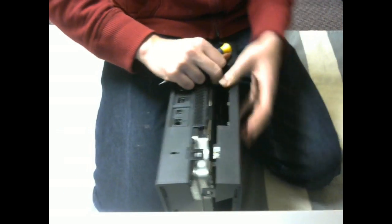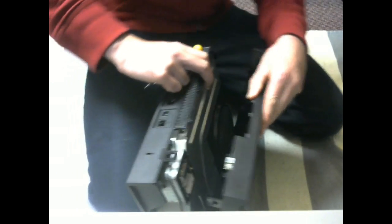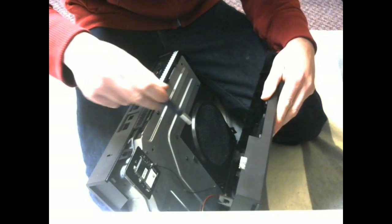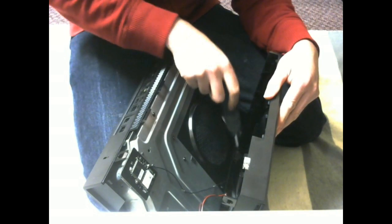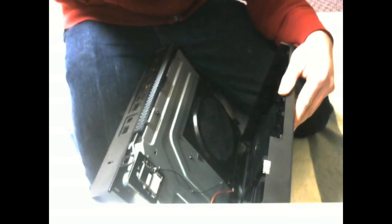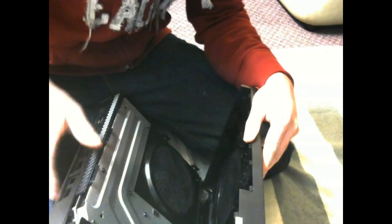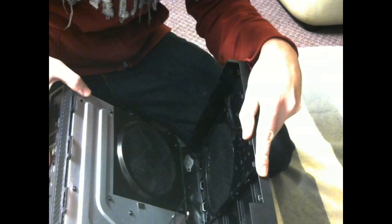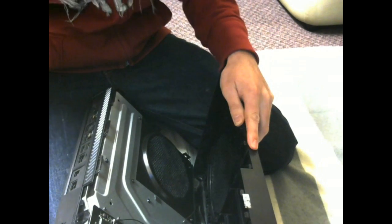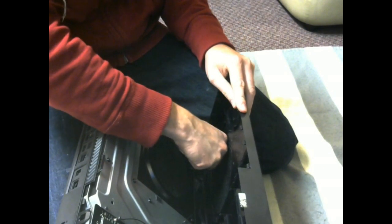Now when you get the last clip done, just pull it a bit more. You can look right down the middle — it'll pop out there. You can see some clips here. Take a bit of screwdriver — you have your flex ribbon right there. There's a flex ribbon down there. Now you'll see all these clasps right here, so put it on the side by the dented edge here and just kind of pop all the clasps off.